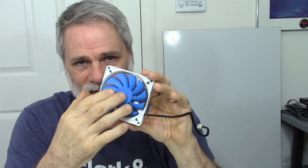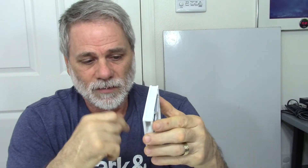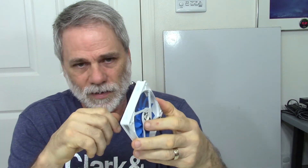What I did is I put this back in today, then just took it back out again — I don't want to keep removing these little pieces from the back and breaking them. But I had it in there a few minutes ago, powered the computer on, and it was whisper quiet the way it's supposed to be. So I think every six months to a year, take it apart, clean it up, get the gunk out, use a very light coating of WD-40, make sure it's cycling well, power it up, and check it.